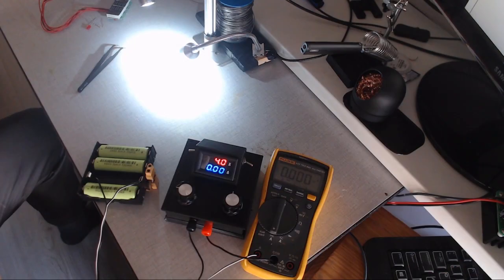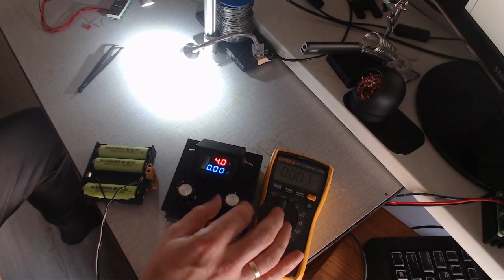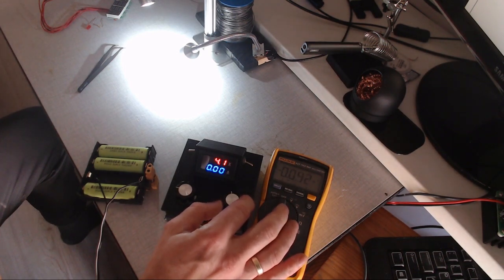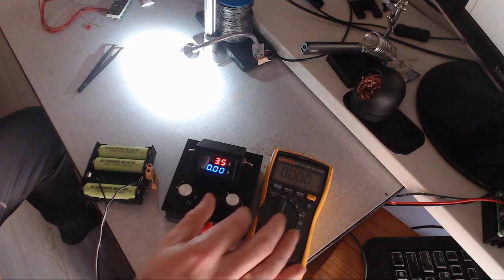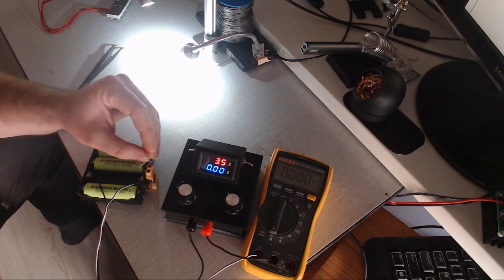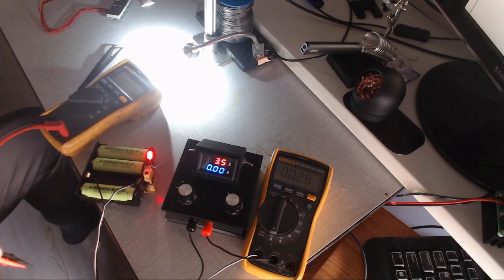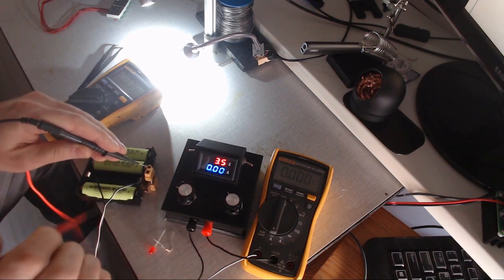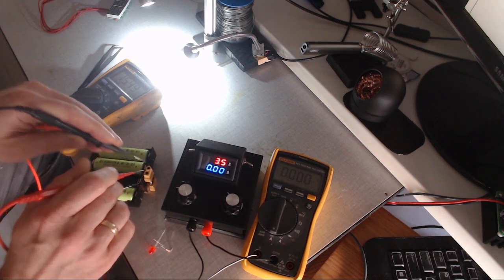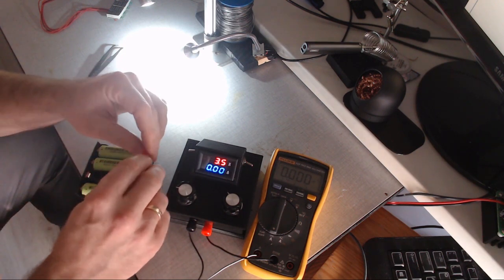Let's test that out. I've just shown you what the over-voltage protection looks like — it's on, now it's off. The over-voltage protection is working. But what happens when you have an under-voltage? Well, we need a load — the output switch will do nothing without a load. I just connected an LED. You can see that the output is switched on. The voltage of that output is 15.5 volts — that's the total voltage of all four batteries. This LED is only drawing 20 milliamps.